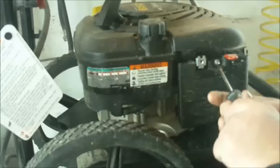What it is, well, it's done. I know it ain't worn out, because I've only used it maybe five or six hours since 2007. That's 5 years. That averages out to about an hour, a little over a year. But no, it ain't worn out. But last time I tried to use it, it was pulling oil up into the carburetor, running out and through the filter. So that means something is stopped up in the carburetor, mostly behind the valve thing.